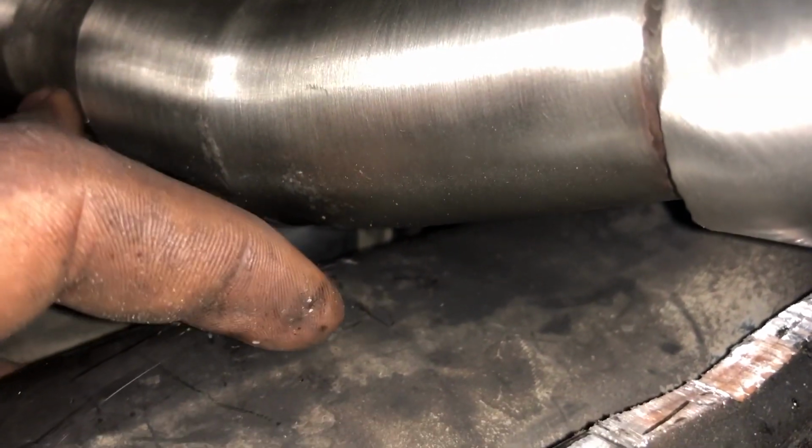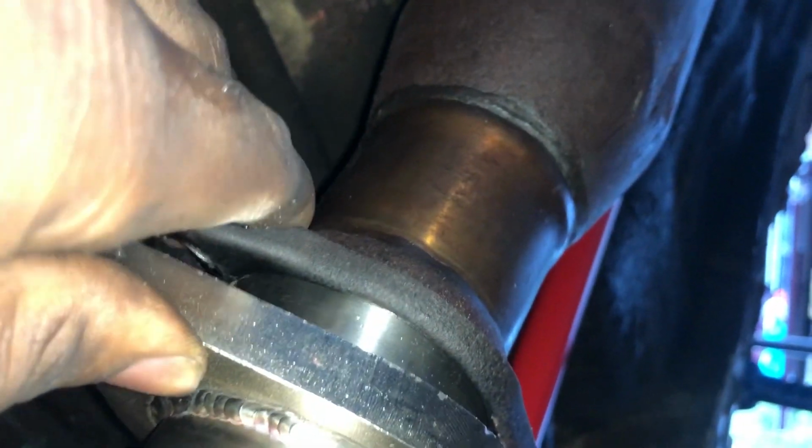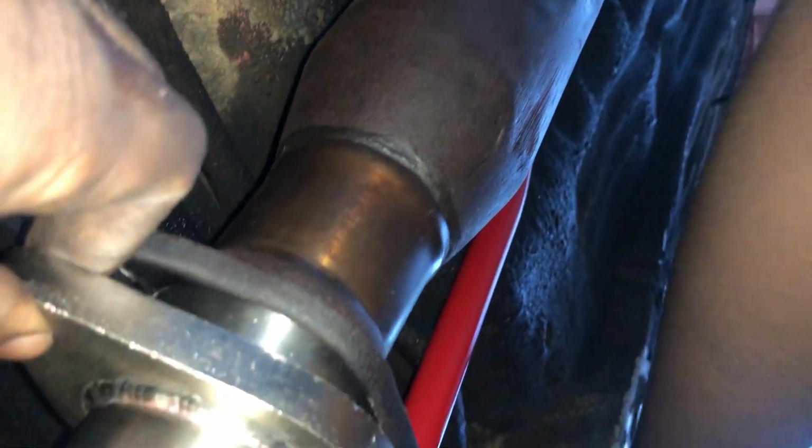There's going to be an exhaust leak regardless because of how the design is. It's not one whole piece. It connects right there at the Y pipes to that one long pipe. And it connects to my existing exhaust. I'm just gonna have to figure something out with this. There's still gonna be a leak there as well, but I can run it for now, I guess.